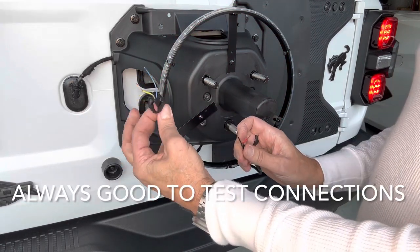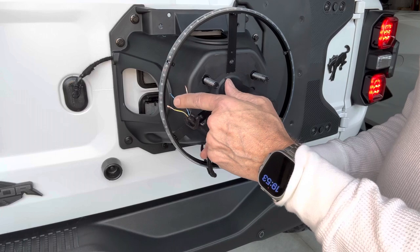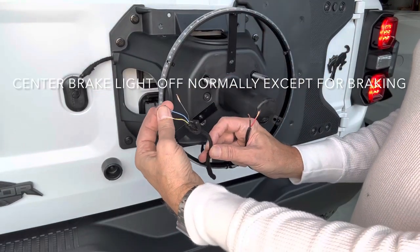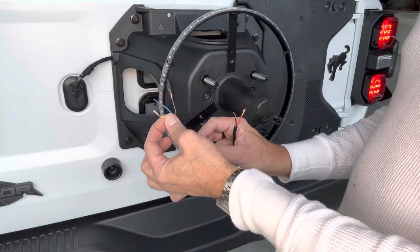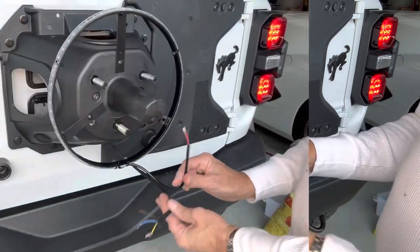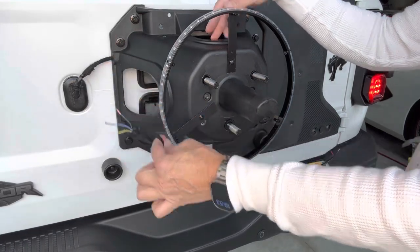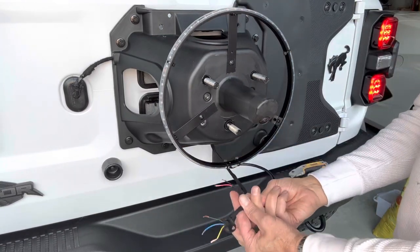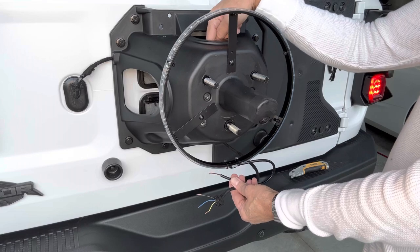On the Bronco Raptor there are three wires - one is tied to the courtesy lights, but since that light isn't on while driving anyway, I'm not worried about it flashing when I unlock. The yellow one is the brake power supply, and the black with green is the ground - that's what both test out to be. The factory OEM cable comes out of the top, so I tucked it down to the bottom hole so the two cables could meet there, and after splicing I'll route it back up through the hole and zip tie it inside so it doesn't rattle.